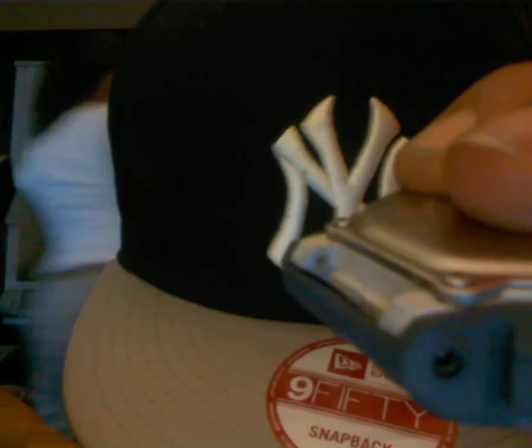So now to put them back, these can be tricky. The bands, putting the bands back can be tricky sometimes. So what I find easiest for me is insert the push pin into the hole, and then with your thumb hold one side and block it, so one side's poking out more, so this push pin can't go down anymore. Inside of here you'll see these 2 holes, and that's what the pins have to lock into.